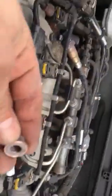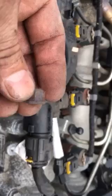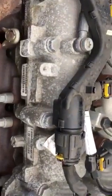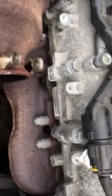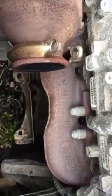And then the great thing is — remember, you've got an Insignia — so even things like the bolts, the nuts on the exhaust, you'll notice on installation they've obviously put copper never-seize on it from the factory, so that's good. Even things like your sensors are fairly easy to get out. All in all, it shouldn't be a tough job. It took me about half an hour to get this out, and it'll probably take me a little bit longer to get it back in.